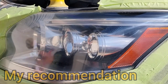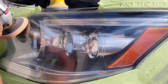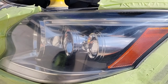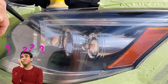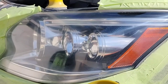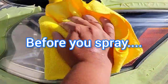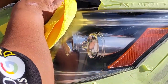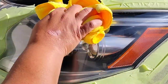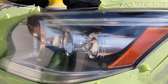Always check for scratches or blemishes before you seal. When someone tells me they got to their last step and have scratches there, I ask: where were those scratches at all your checkpoints? They were there. A lot of people get lazy with headlight restoration and aren't inspecting. Before I do anything I'm looking over all these spots and checking that whatever is there is going to be gone or filled when I spray. You have to learn to distinguish between tiny nicks that will be covered by the clear coat versus those that need attention.